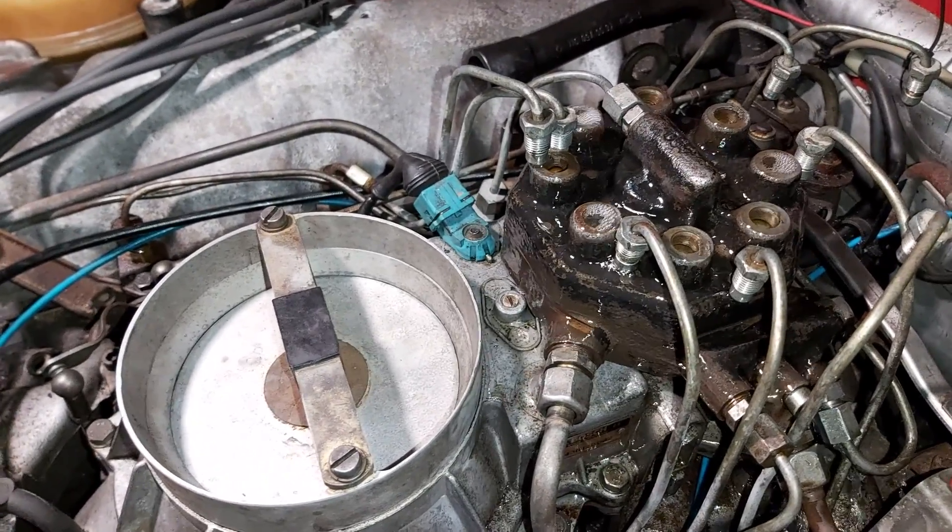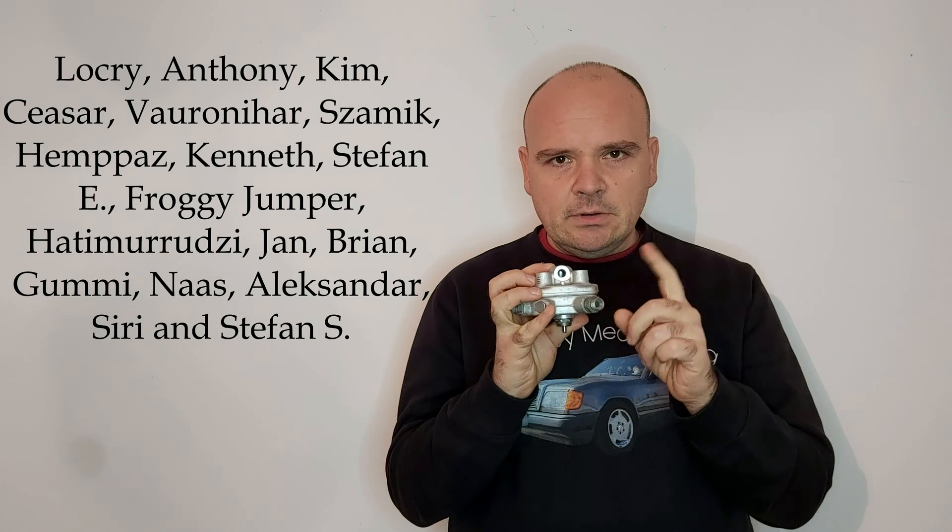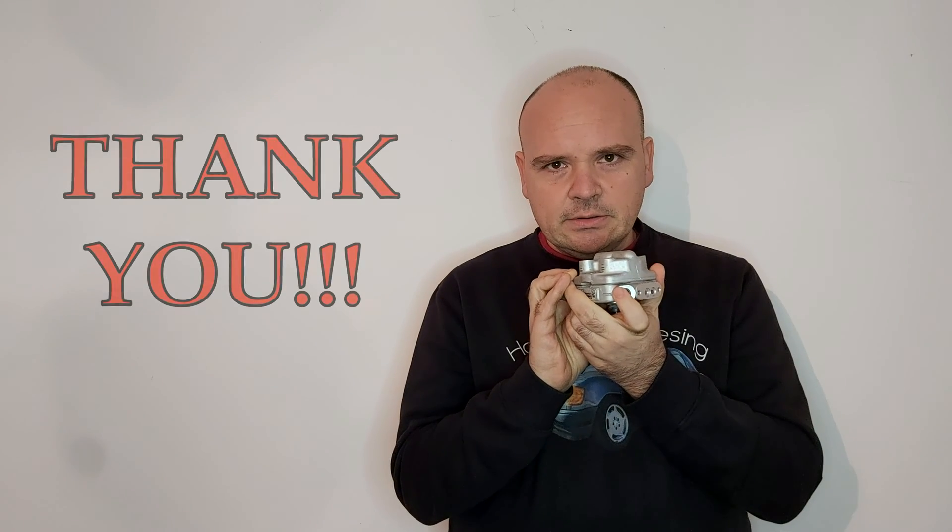If you have done something wrong, it looks like this. If something like this happens, it means you could have mounted these fittings in the wrong place — for example, the fitting that goes to the fuel pressure regulator is mounted where the feed line is, and not where the fuel flows back to the tank.